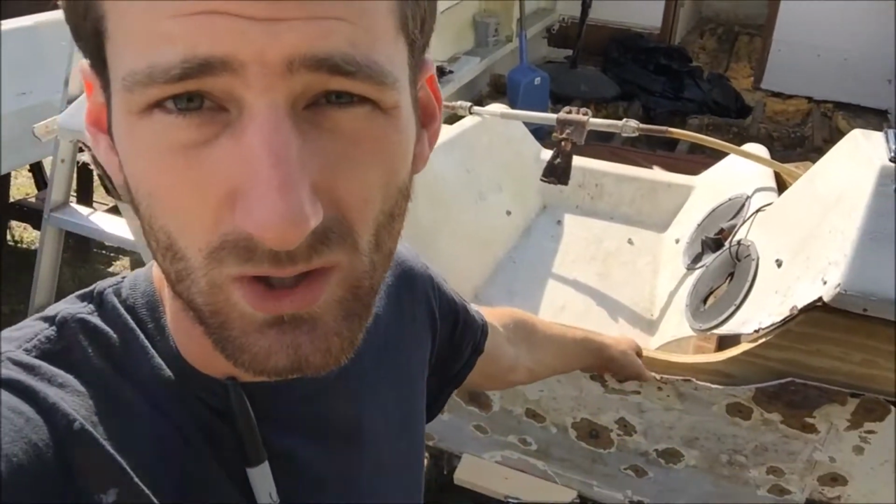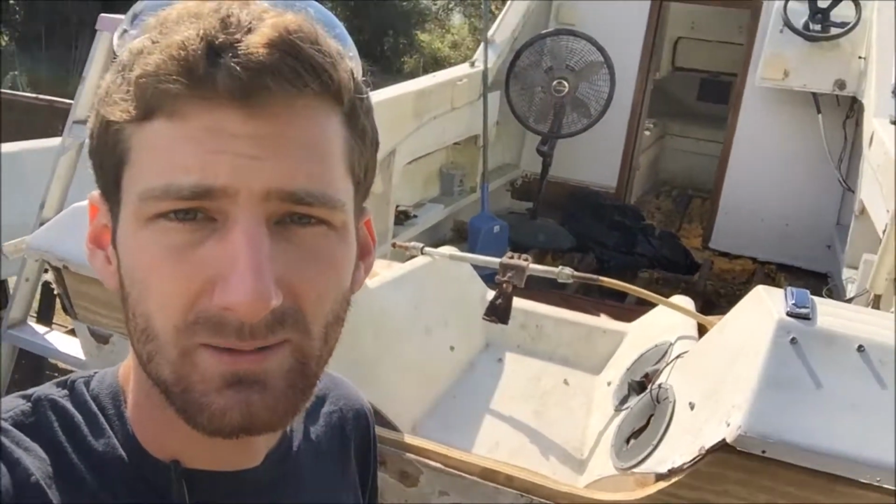Now that I got it to fit, I'm going to go ahead and take this piece out, and I'm going to lay it on what's left of my sheet of 3/4 plywood and trace it out again, because I'm going to have to sandwich two together. Another reason why this hole had to be so big here. And then I'm probably going to glue them up using Titebond 3, the waterproof wood glue. I'm going to clamp those and let them sit up probably overnight, and then I'll start coating them in resin. And then I'm going to go back and do some more glass work on the inside of this and get it ready for gluing my wood. So that's what I'm working on today, and I'll see you in the next clip.